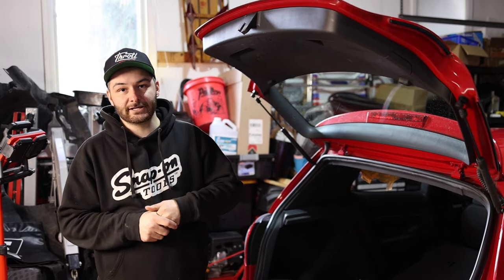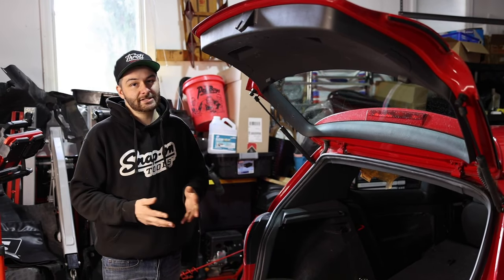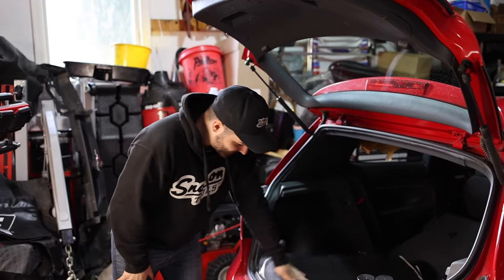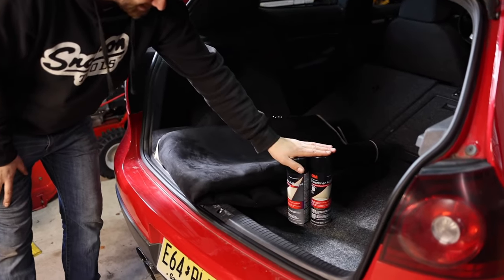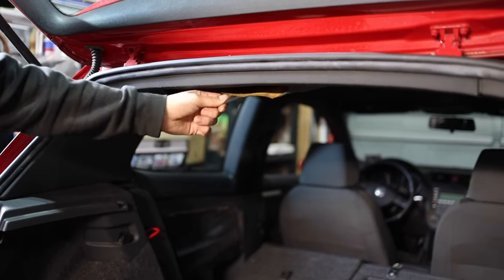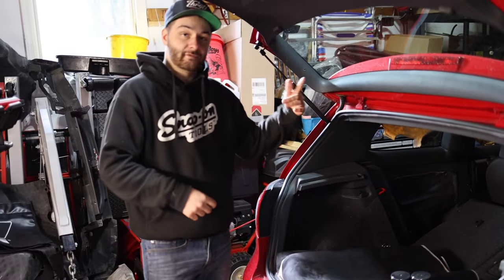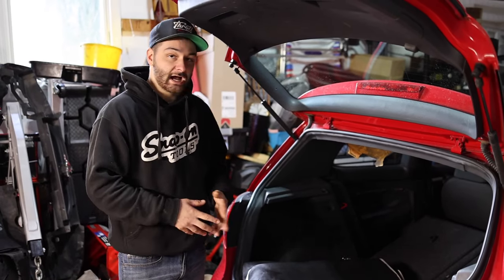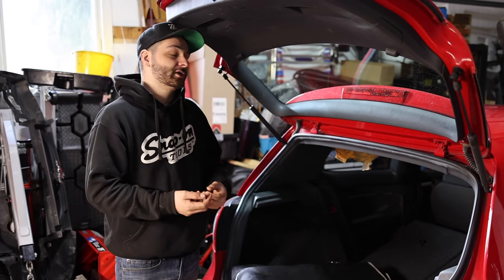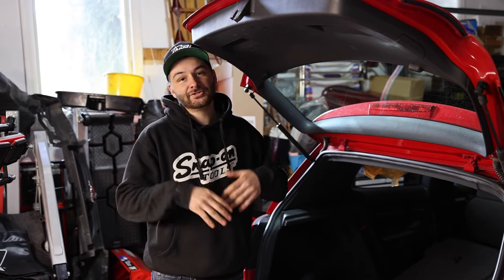What's going on everybody? Raptor Unch is back for another video. Today we have the Mark V GTI. We're going to be doing something that most of you guys are experiencing or have experienced. As you can see we got some headliner fabric here and some adhesive spray. You can see unfortunately the very notorious headliner sag — it's very common on the Mark V and Mark VI generation for the GTIs, Jetta, Passat and so on. From the factory these cars use way too much material and over time the glue loses its strength and the material starts sagging.